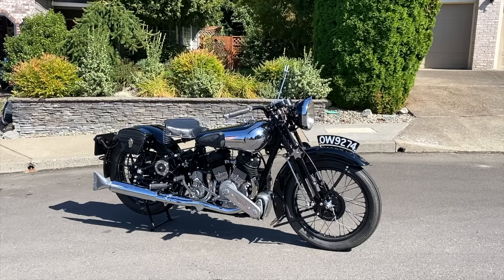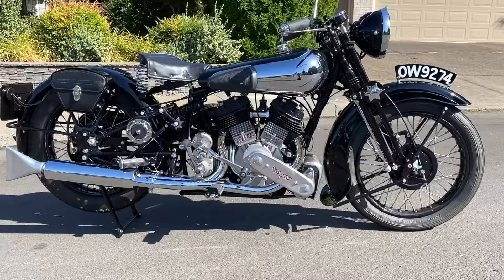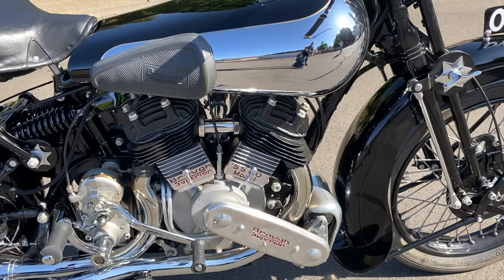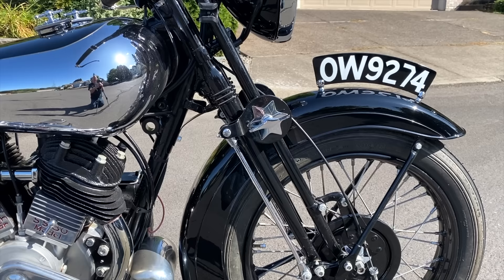The engines of all the Broughs were bespoke handmade motorcycles — they never made their own engine. Instead they took the best proprietary parts at that time and modified them to their own specifications. You may recognize this engine actually comes from a Matchless Model X motor. It's very similar to the Model X but Brough had specific requirements from Matchless, including a request for larger ports, higher compression cylinders, and hotter camshafts.